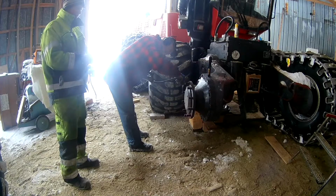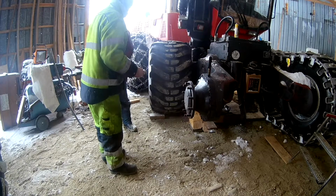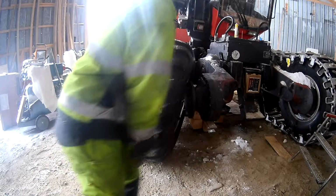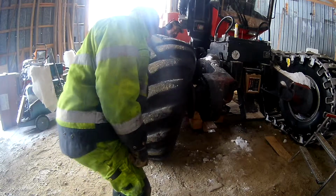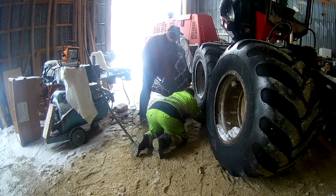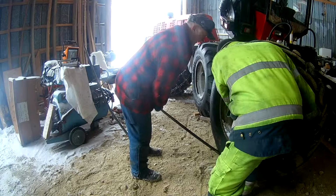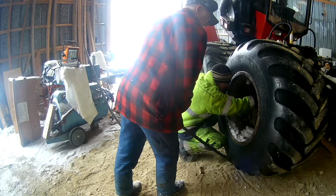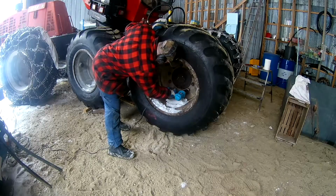Tighten the nuts back up. Added some grease to the threads. And then we wrestle the other wheel back in place. Had to lift the rear one a little and jam a piece of wood under there to be able to get the front one in place. Eventually it was on there, the nuts could be fitted. Everything tightened up.